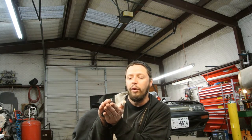I'm going to put in some travel limiters. When the front end picks up and I let go of the button, I got about three inches of travel right now where the wheel drops down from the fender — about three inches of spring travel in the front. So we're going to make some Home Depot style travel limiters. In combination with the weight and travel limiters, we should be able to get the wheelies under control.